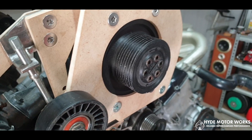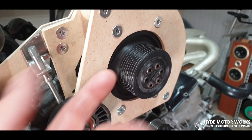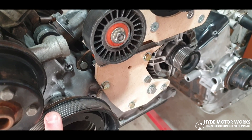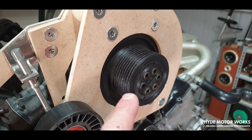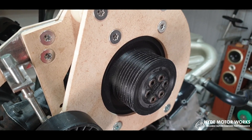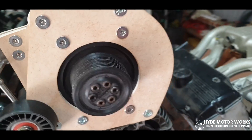The outer six-rib pulley will exclusively run the supercharger pulley up the top. These Rotrexes come with an eight-groove pulley system. Obviously we'll only need six, so we'll use six V's on the crank and use whichever six we want. In general, you use the inner six of the Rotrex's pulley system.